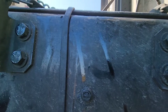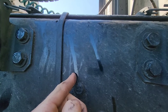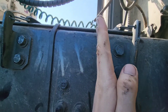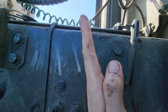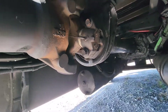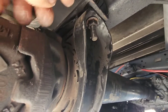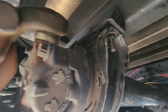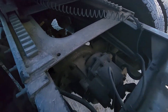So what do you have to do to get the front angle to match the rear angle? The front axle has to be tilted back — meaning this end has to come down to match the rear angle. What you can do is put shim plates right up here and shim it down until the front angle matches the rear angle. You want these angles to match.